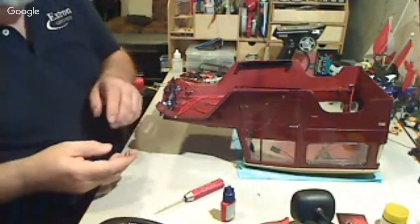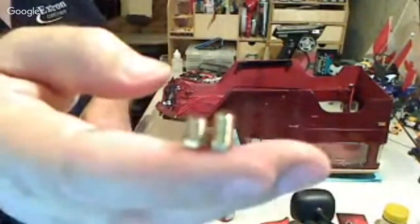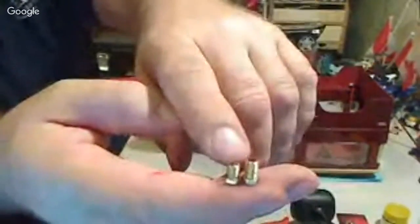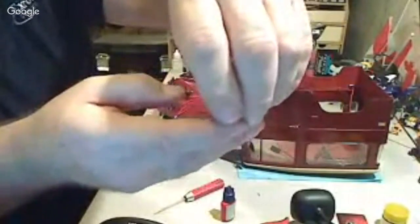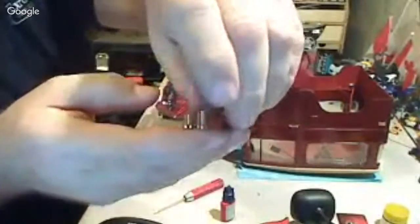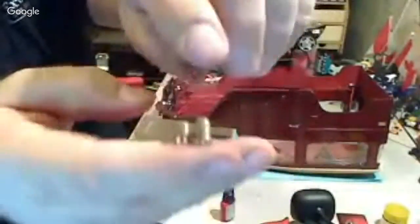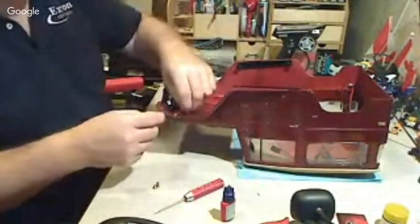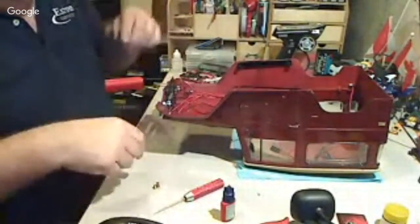Okay. Yeah, they gave you these little tiny sleeves to put the lights on, but one is a little shorter than the other one. The stock one is the tall one, and the new one is the shorter one. What's different with it also is that the slot to pass the cable is a little bit bigger on the short one. And it's shorter because once you have the light in there, when you twist it, they need room for the heat shrink. So that's the reason why they give you a whole new set.